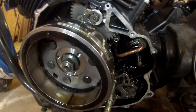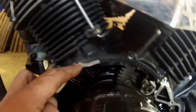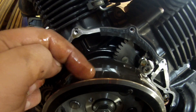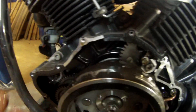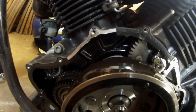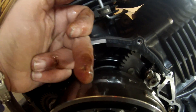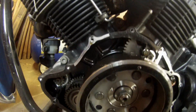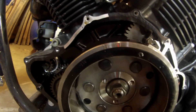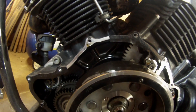I'll probably put a screw here with some wire around it coming out above the T, so I know my flywheel position. I haven't got any way of marking it anywhere else to show me where my exact position is. I'll rig up a piece of wire just to sit above, pointing where my line is — that way I don't move my flywheel where it's not supposed to be. I don't know if it goes back on a keyway or what until I get into it, so I'd rather be safe and have a mark I can line it up with later.